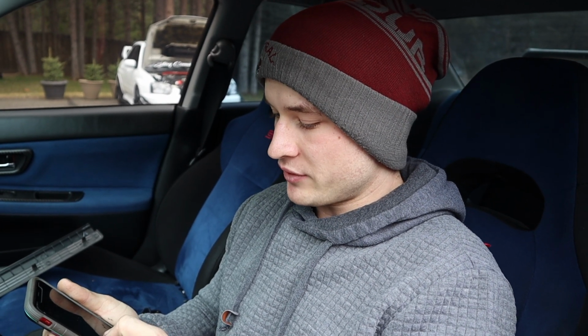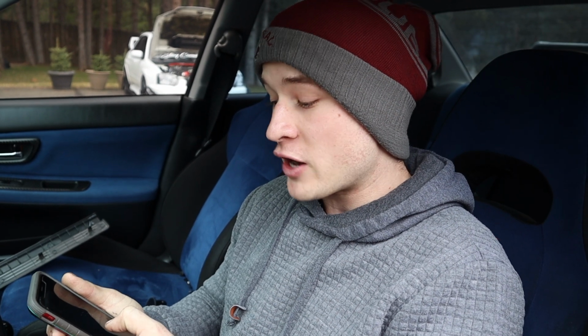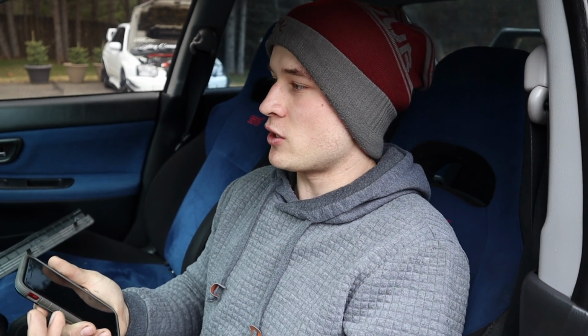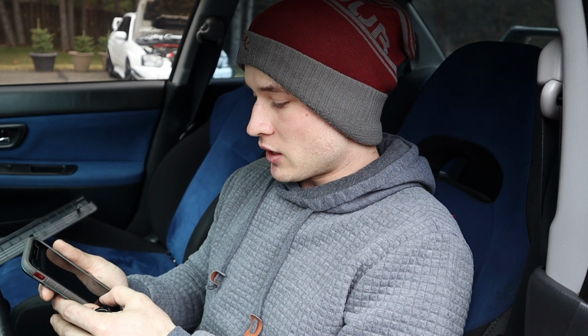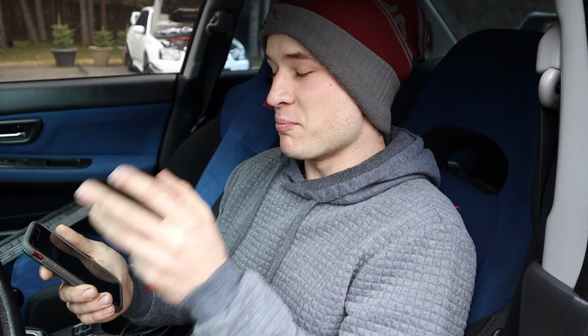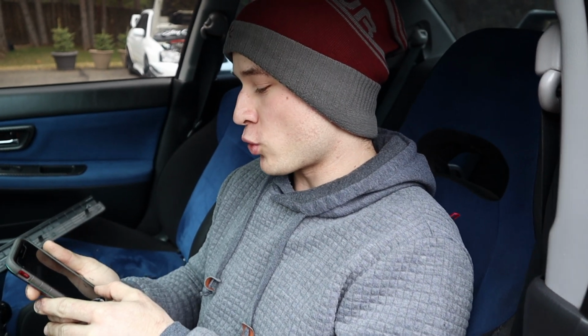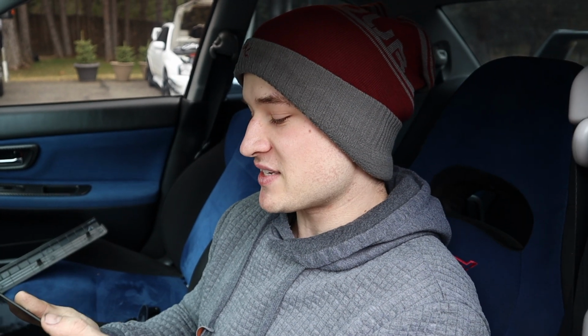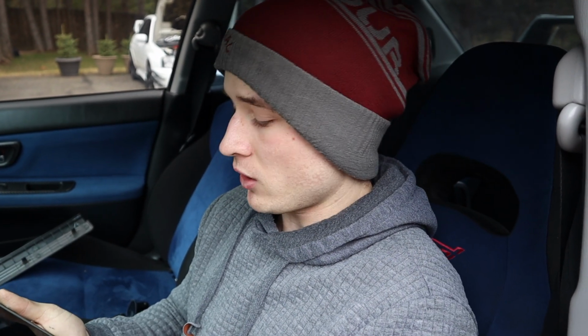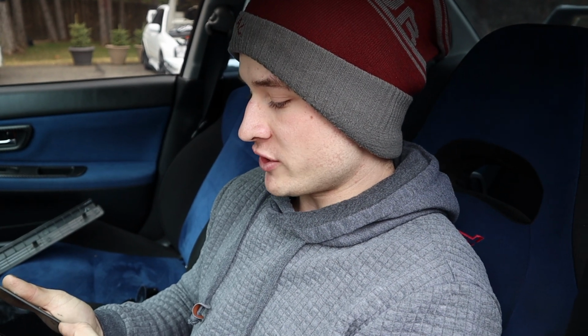The next step after that says drive the vehicle very easy for the first 50 miles using a break-in ECU map, and like I said before, I'm using the COBB Stage 2 tune, 91 octane. It's mild, nothing huge on it. It says to keep the RPMs below 4,000, so we'll make sure it doesn't reach above that. We won't go into boost. It says in bold capital words, 0 boost, 1 to 2 psi max, and then vary RPM in load conditions while driving and shift down on decel. Engine brake whenever possible. Engine braking equals good vacuum conditions equals happy engine.